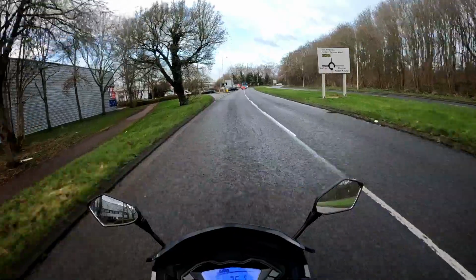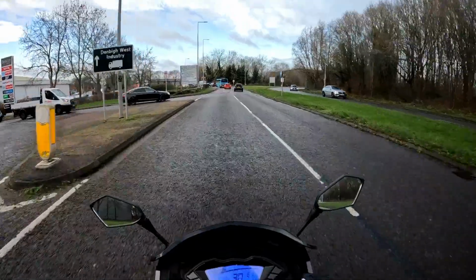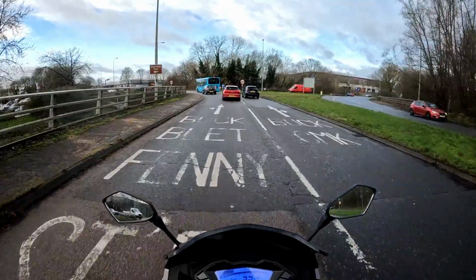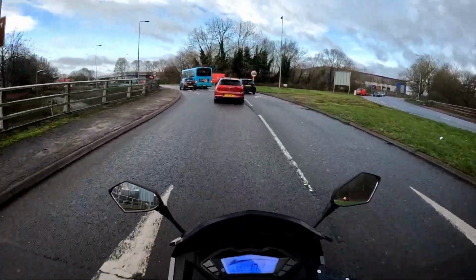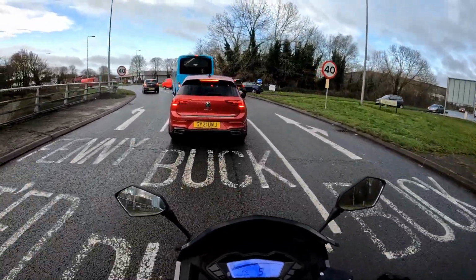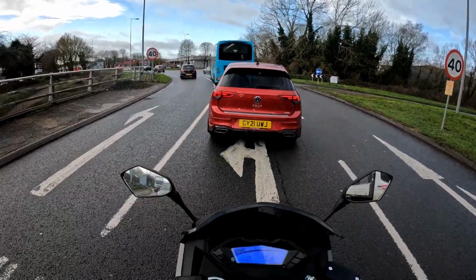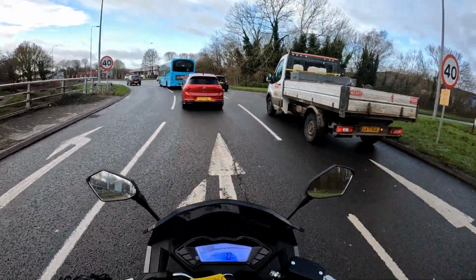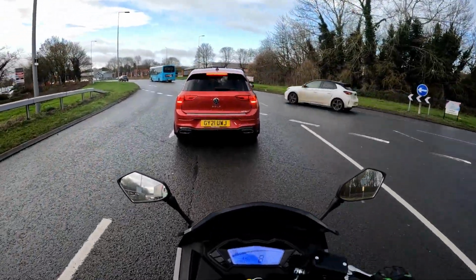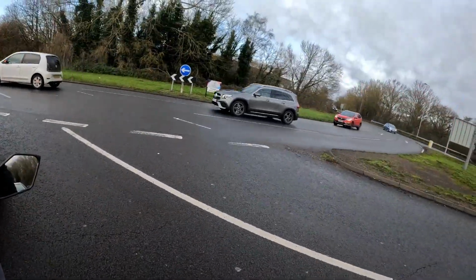But if you don't keep an eye, and it's part of your checks that you should be doing all the time: tyre pressures, indicators, lights, fuel, oil and water. That is one of the things you should be doing all the time as part of your weekly check. If you're going to neglect your bike, unfortunately it is going to lead to mega problems. So we've noticed that with 2 LXSs, and it'll be the same with the LXRs as well. Water-cooled bikes do not like being run dry or hot.